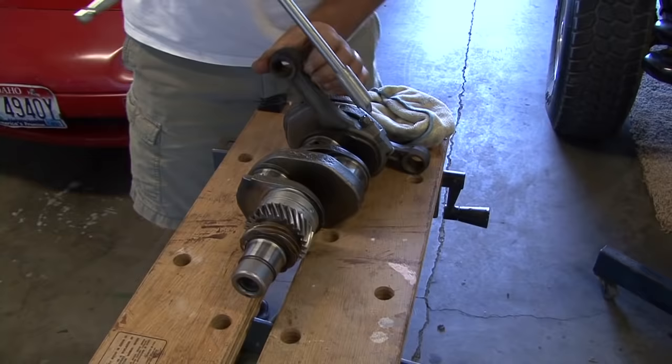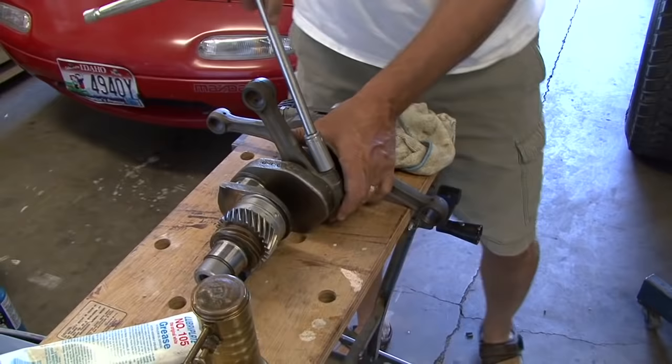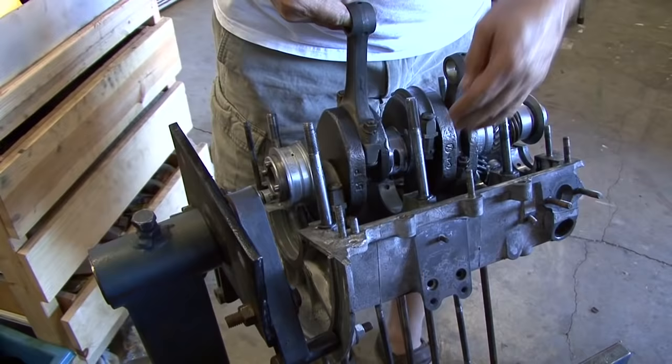And then we installed case savers, which is really important on VW motors. That's so that the studs don't strip out of the block. We were able to redo the heads, put new, and it doesn't take valve guide seals, which is interesting. So the heads are all done, everything looks clean, things should run like a bomb when we get it started.